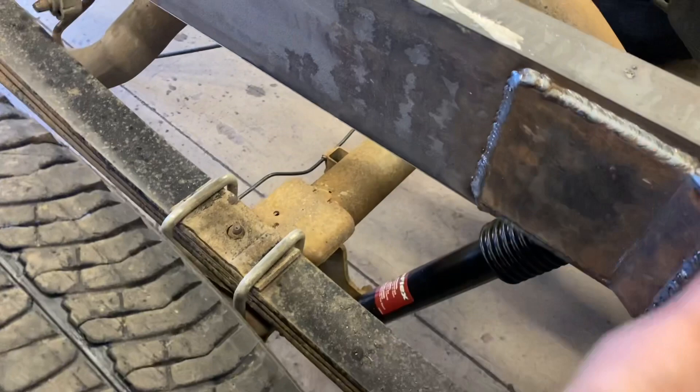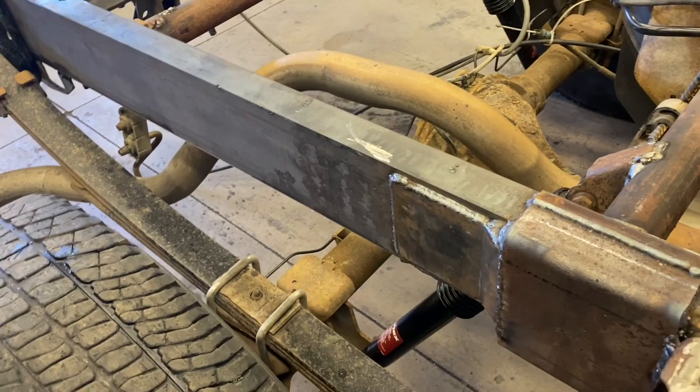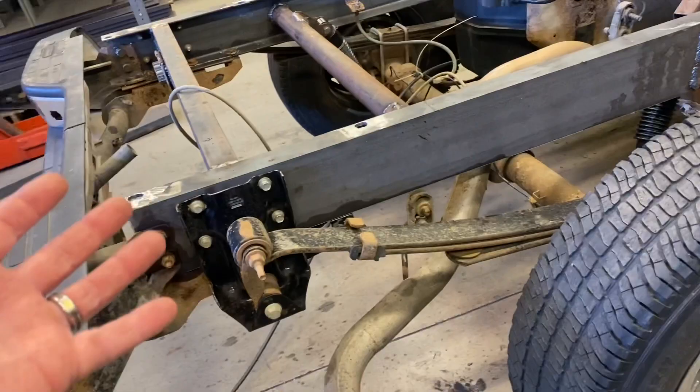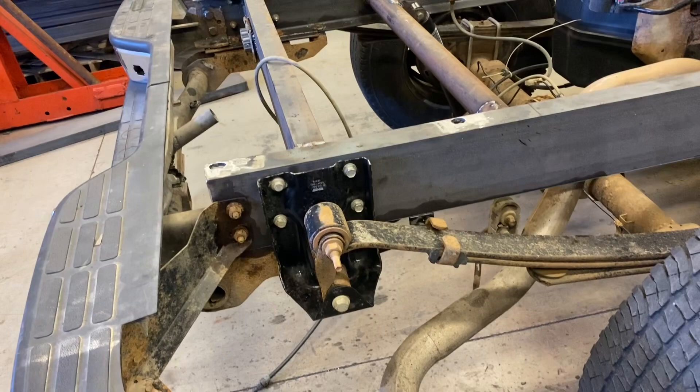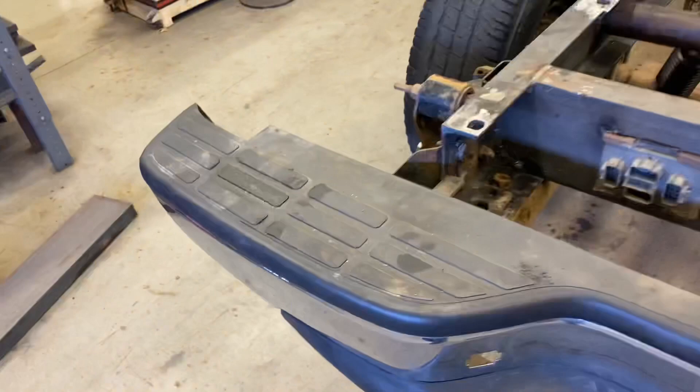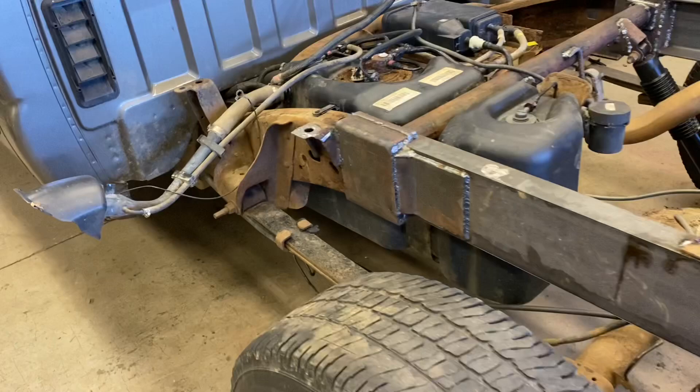This piece here I did bend, and I used a piece of flat bar to weld back in to splice it. That gives it a little rigidity sideways and makes it look better — wasn't exactly necessary but it worked. Everything else just bolts on. I drilled holes to bolt the bumper on, and brought the spring hangers — basically your springs stay attached in the front, and back here in the back you jack it up, get the height right, square up the hangers, mark your holes, and drill them. Pretty simple. Got the bed bolt holes cut out.